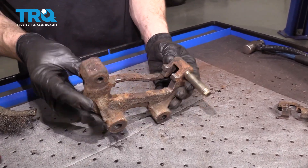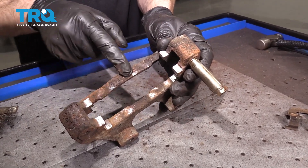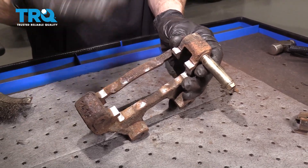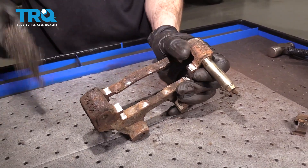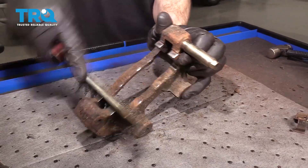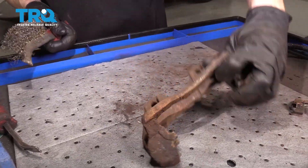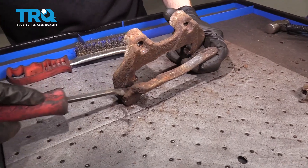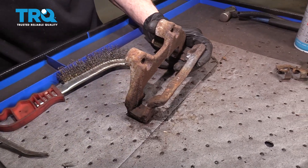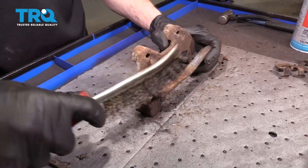At this point I have all four corners cleaned up. We're going to pay attention to a little bit more rust. Commonly you're going to find a whole bunch of rust buildup on that caliper bracket. It might not seem important, but if any of this rust makes its way into the brakes while you're driving, you're going to have a braking issue. Just go ahead and try to chisel it off and then sand it down with that wire brush. Then turn that bracket over and pay attention to the areas in between, right in here and over on the other side — that's where the rotor is going to be spinning through. Make sure it's clean and free of any debris. Let's use our wire brush.